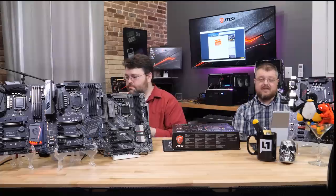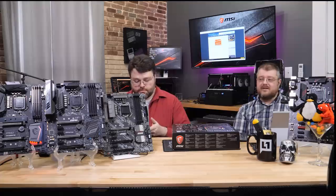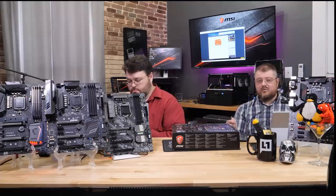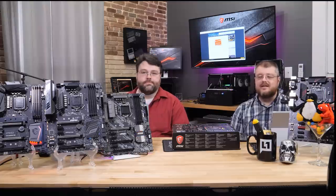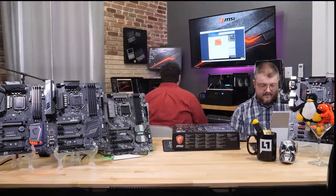But you do have to keep in mind that because of the PCI situation, in certain configurations, neither your PCI Intel NIC nor one of the killer NICs will work. So you got to keep that in mind if you're thinking about loading up a bunch of stuff in these things.